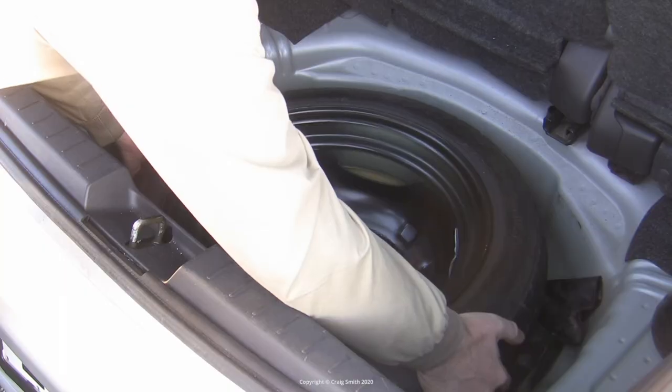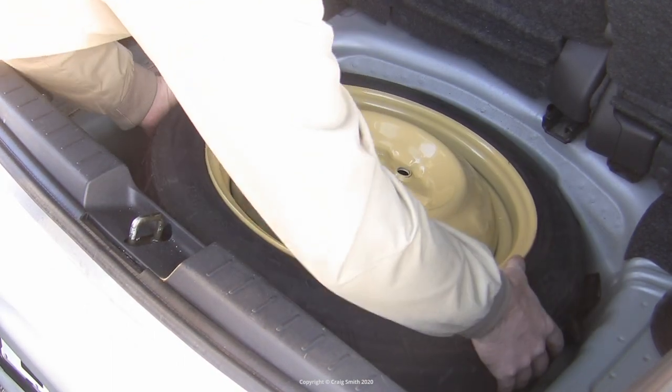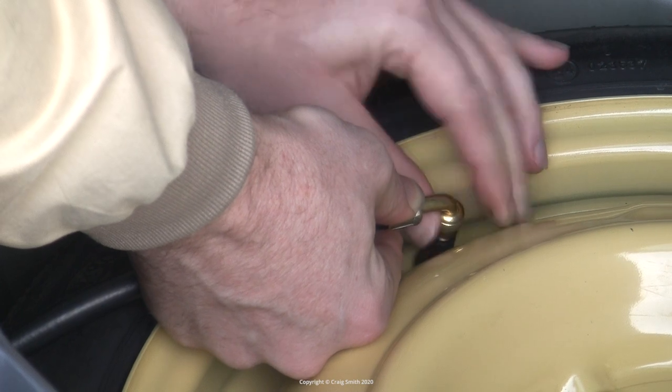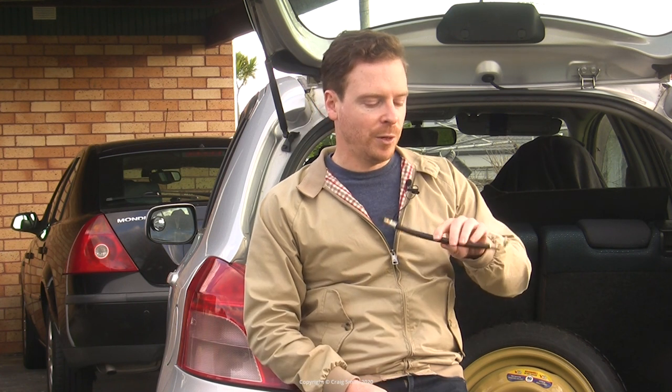In conclusion: when you come to actually use the spare wheel, if and when you ever need to, you are going to have to take this extension off before you mount it to the car - perhaps in the middle of the night on the side of the road in the rain. You want to do it quickly so you don't lose pressure. Hold the right angle as still as you can, get your fingers at a good angle, and undo it as fast as you possibly can. From my own experiments, you don't lose anything like enough to be a concern. So this is my recommended solution to that little Toyota irritation - I hope that was helpful!